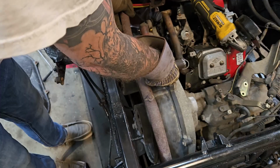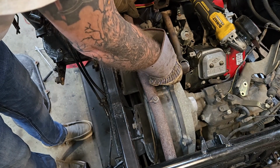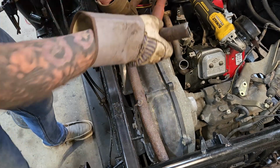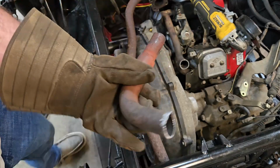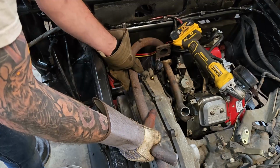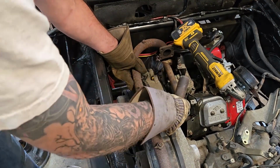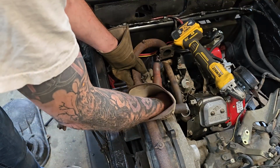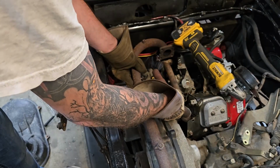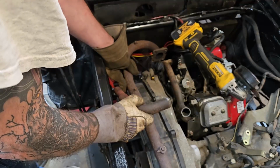How does that leave us with this? That doesn't really help us too much though, because we almost need to come in a little closer here, because this radius, hopefully you guys can see what I'm pointing at. Let me crank it up a little bit. There we go. This radius is going to be a fixed position. Like this is going to sit over here, somewhere right in here like this, when it's bolted to the muffler. Keeps it off of this. I need to make sure that this is going to get to that. So if I do it this way with a pie-shaped cut, I'll be able to bring it over. Although then it's going to get into this. So this is going to have to move out here regardless.